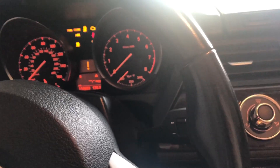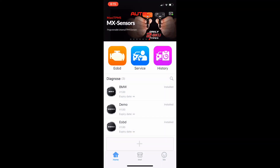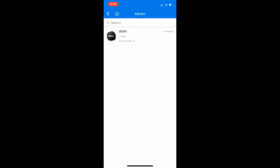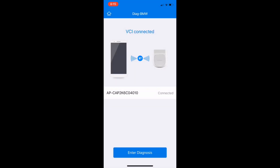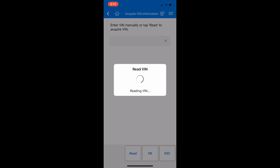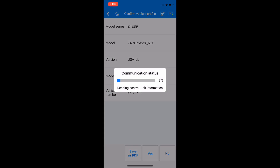I've plugged it into the OBD2 connector slot and put the car in the on mode — just the on position, not started. Now I'm going to go to the app. We're going to go to Service, then look for the injectors menu. You're going to click automatic selection to scan for your VIN so it has the proper information for your car and engine. The scanner will now load all of the system data and all of the modules — this probably takes the longest amount of time. I think it took two or three minutes; I've sped this up so it was four times as fast.